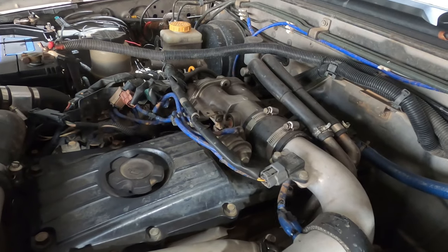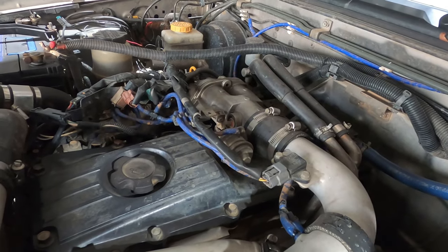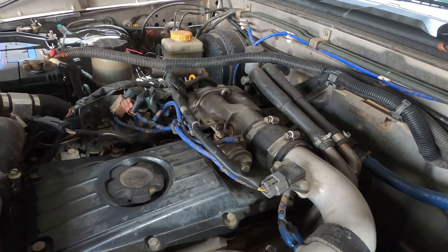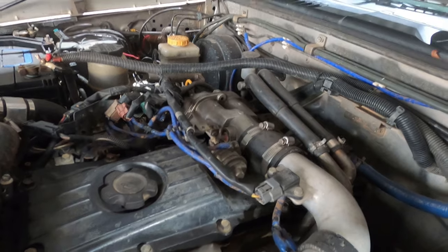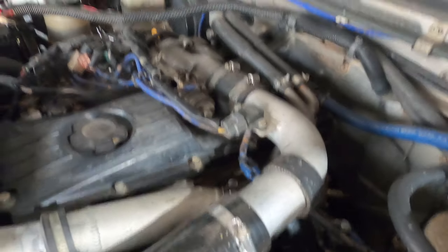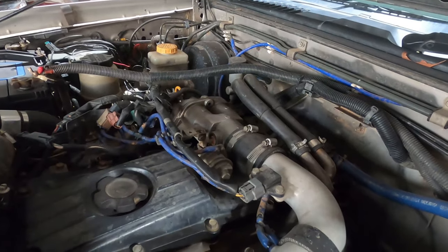It's just like in a petrol car that isn't running a blow-off valve — when you're going hard on the accelerator building boost and then come off, the throttle body closes and the boost has to go somewhere else. So it goes against the turbo, which is when you get that flutter noise.